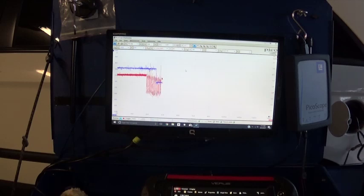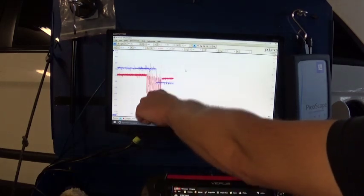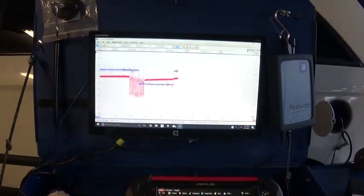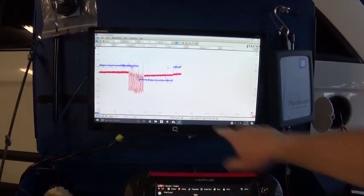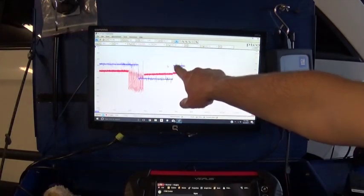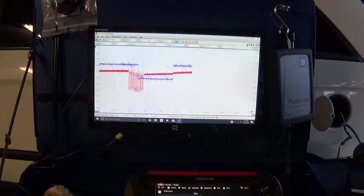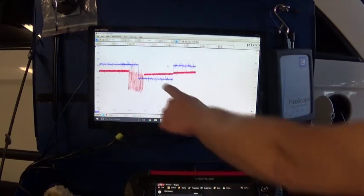Okay. Now the switch is closed at this time, but I see a nice crisp line in my other car. We had this crazy thing, now I can see on my scan tool the switch is closed. You guys can see that. You can see the switch is closed, but it opened right away. So I'm not sure why the switch was goofing off a little bit, but it seemed like we have a problem here. We cannot hold the vacuum.